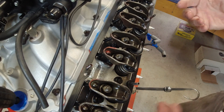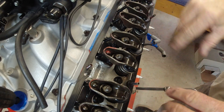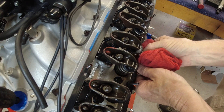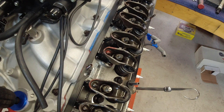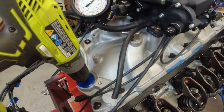What works is if you've got an old pair of cheap stamped steel valve covers, you can just cut the top out of them, bolt them on. That way you can run it and not have to worry about making a mess with your oil, and you can run it all day long if you want. So that's how you check — make sure you're getting your pump primed, getting oil circulation, and also check to see what your pressure is. I'm real happy with that.